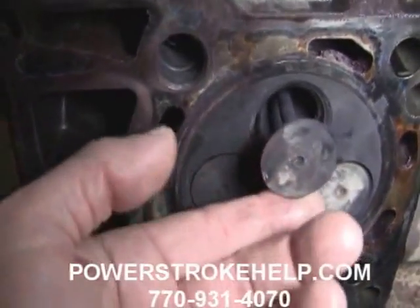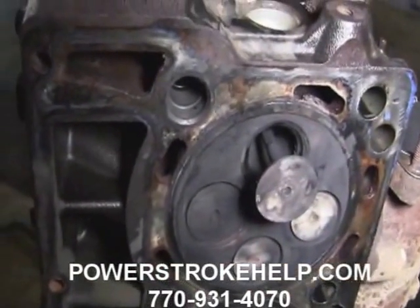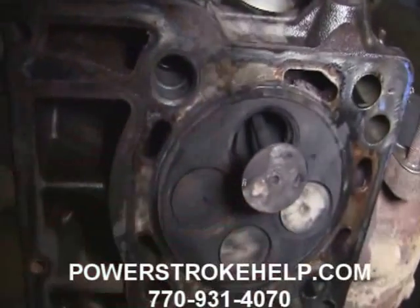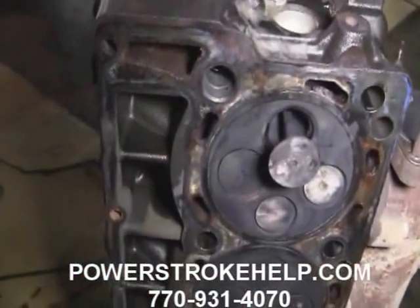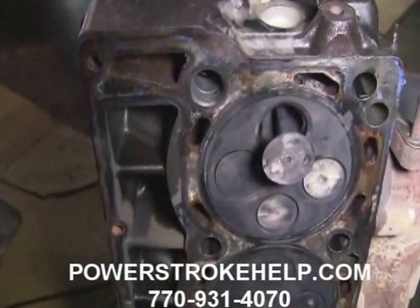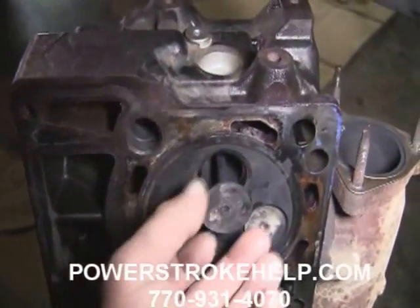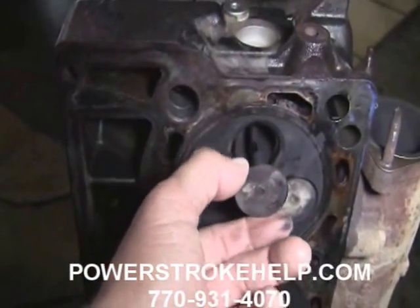That's just insane. I have never seen a valve guide in all the years of working with cars, trucks, boats, and motorcycles wear out like this. And this goes back to why we produce the Big Dog Diesel Cylinder Heads — the Big Dog Cylinder Head puts in a bronze guide where the valve actually rides against bronze, not steel.